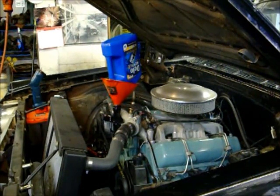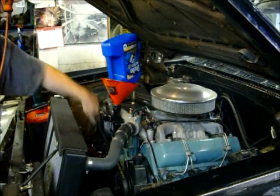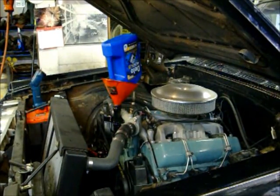It's happened. I had one 2 years ago. Guy had a small block in a Chevy pickup. All of a sudden, it made this horrible racket, and the lights came on the dash, and he calls me up. He goes, "I don't know what happened, I think I broke a belt." And I came out there and looked, and nope, the water pump pulley cracked and it fell off. Yeah, it was an older truck. It had a lot of miles on, but that stuff happens. Like I said, it's old stuff. So it's another little useful tip.